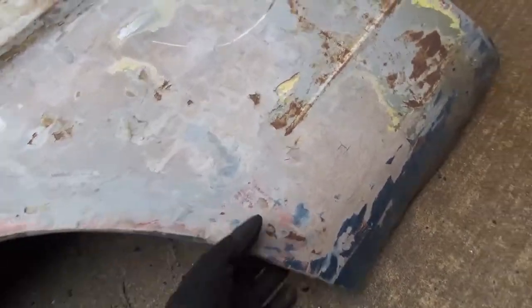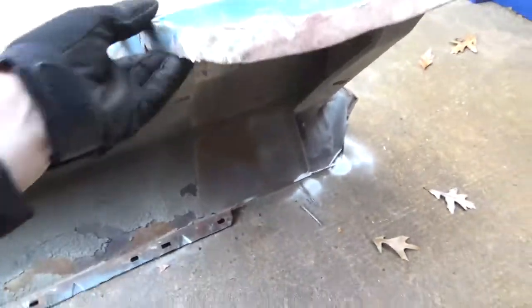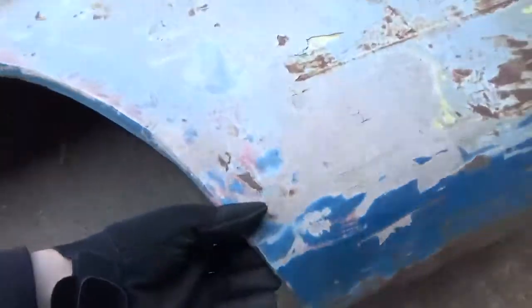There's a lot of Bondo right here, and if you look at it on the back side, there's quite a bit of damage in there. You can see some spots where Bondo is poking through. They used the old body man trick of putting a screw in it and using the slide hammer to pull that back out, then smoothed it over with some Bondo on top.